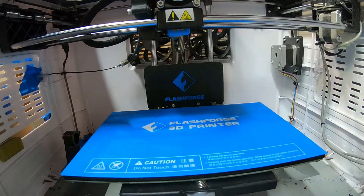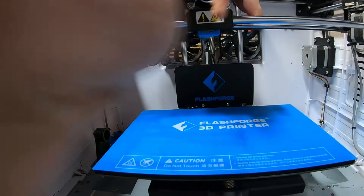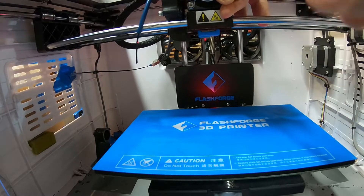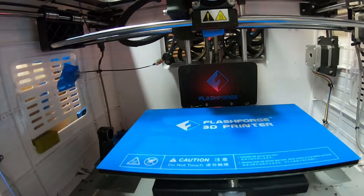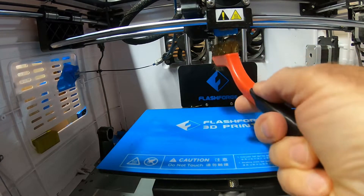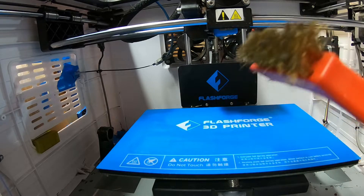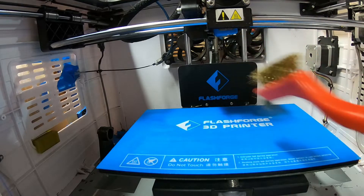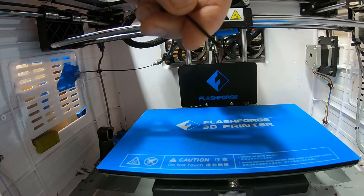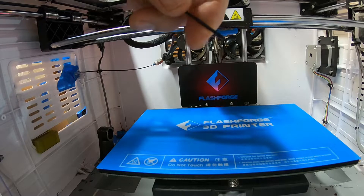So now the print head is as clean as we can get it. But there's still residual PETG in there, and we don't want that mixing with the PLA — because we're going to be running PLA at 225 and the PETG is not going to melt properly. Tighten this back up, then we'll go ahead and use our brass brush and wipe off the bottom of the nozzle. That's how you keep it super clean. There are links in the description — not these exact ones but similar. You want a brass brush because it's soft and won't scratch the nozzle, particularly this one which is nickel hardened with a nickel coating that's harder than brass.